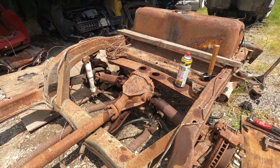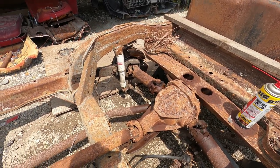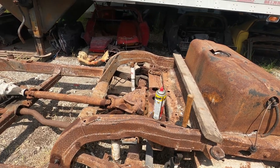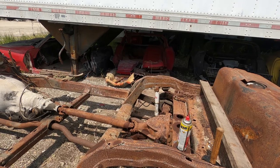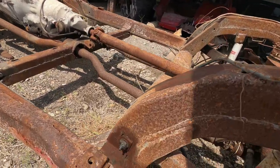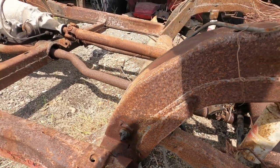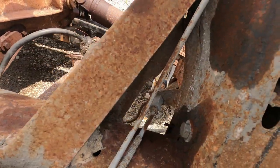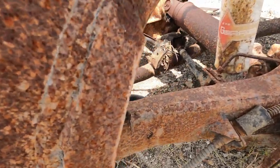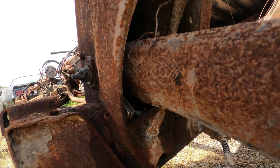You've got a brace underneath here that fits in. The thing about this that's so aggravating is that this is all metal and it tends to corrode over time, just like this one has. You can see nothing here looks like it would be friendly to get out, and most of the time it's not. We did have a benefit in this case where some hardware was replaced here. The biggest thing that causes people frustration would be this bolt right here. The body is off of this car so I have a lot more room to work with — you can see there's the head of the front trailing arm bolt and the back side of it tucked in that pocket. With the body on the car you have very little room to work with to get that bolt out.